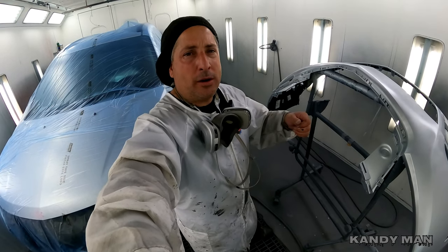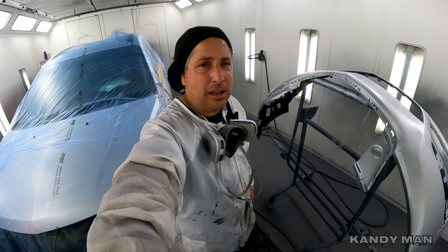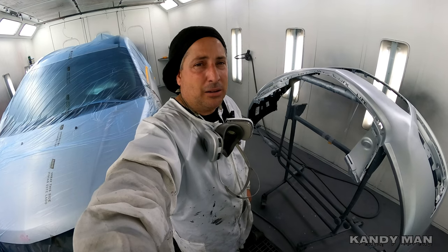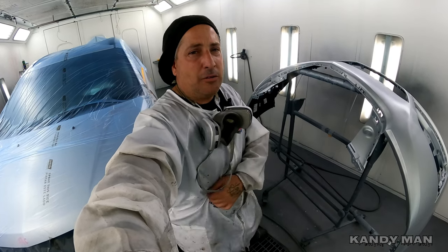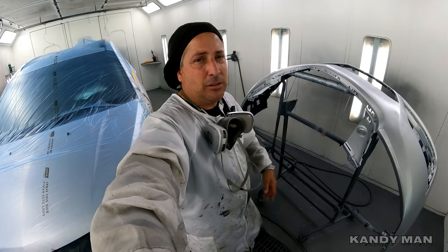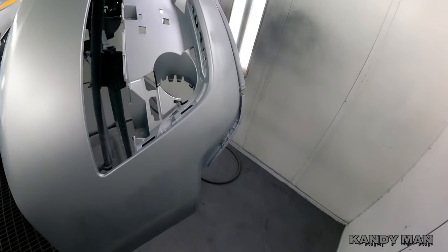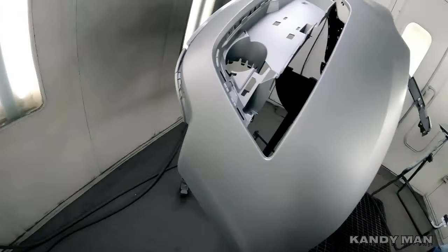We put two coats on — I went up with one, pulled back a little, and put another one on wet-on-wet. When I'm doing silvers I like to get as much on as I can because it's a thicker paint, and I like getting it all on at one time so there's less chance of dry overspray, mottling, or streaking. The best way I've found with silver is to put on a wet coat, back up, dust it, and get your coverage. Then all you have to do is an orientation coat — you don't want to keep putting more and more silver on. Get coverage and then do your control coat. I'm running that gun at 13 PSI for my coverage coats and it definitely puts it down nice and even. We'll let this flash off and then get into the drop coat.